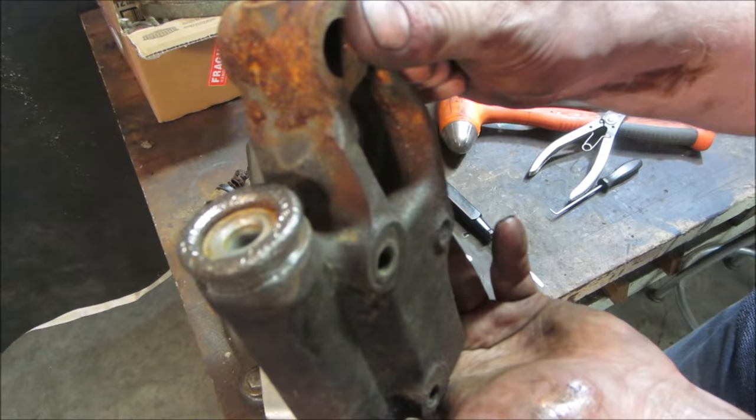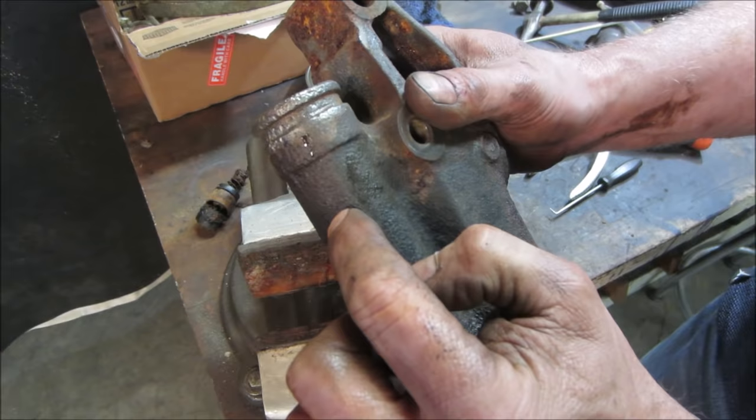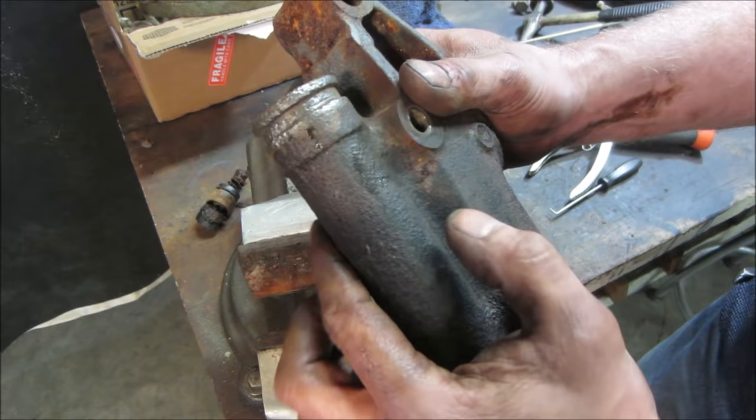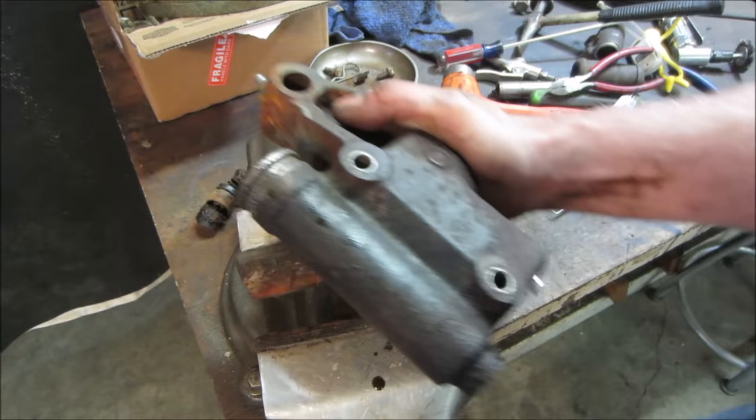And we'll shoot some oil in there. And then we'll see what we can get for a rod to fit down, like a brass rod or something. I don't know what's in there. I think it's probably just going to be like a square plug on the end of it with a seal going around it. I don't know if it's got a seal going around a piston or if it's just a cap all the way through. If it's a cap all the way through, the problem is we're going to put a rod against it and we're going to be pushing against that rubber and destroying it. But it's worth a shot. Let's see what we get.